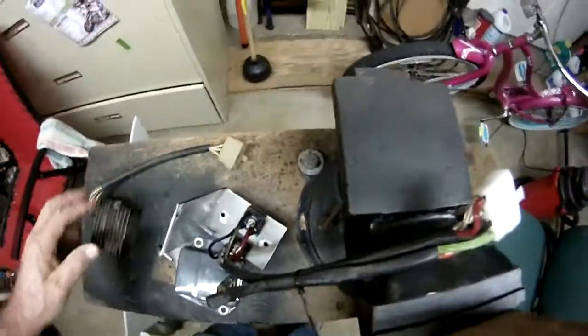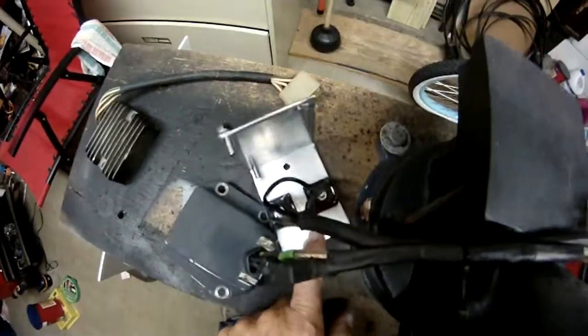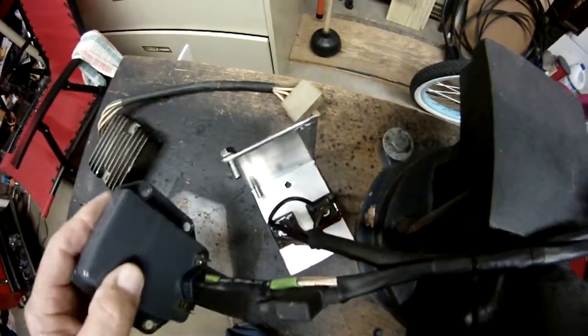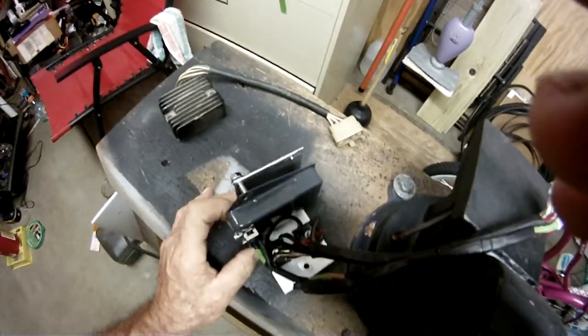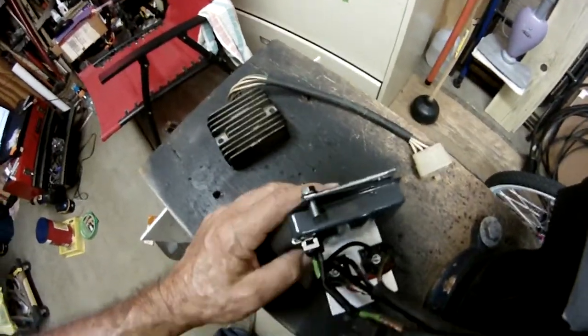This rectifier regulator is still good. I made this in this kind of configuration so I can get it up in there. What I will do is bolt this plate on, and then once I get it bolted, I can push this up in there and bolt it using nylon lock nuts and lock washers, and bolt that in place. In the back here you can see I've got two holes — I'm just going to zip tie that on. That way it's good and tight.